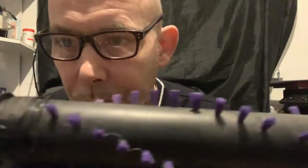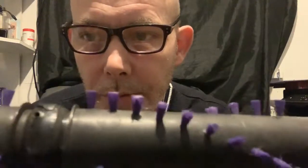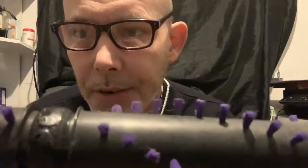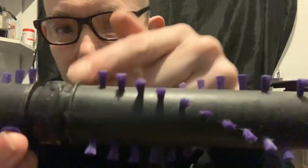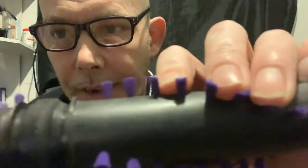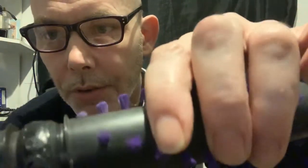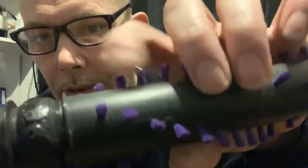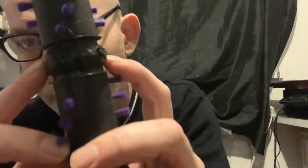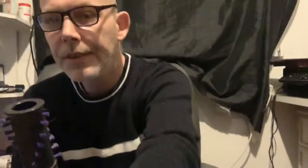So to fit another belt onto there, people do it, but you're just going to cause a problem for yourself, because your belt won't last long, because there's sharp edges on there where it's got hot. It should look like this, and it should look nice. And if you look at this one, it's absolutely mullered. So this is the good one, this is the duff one.